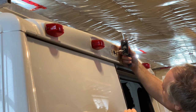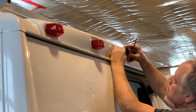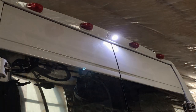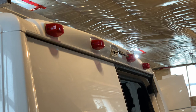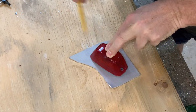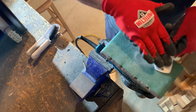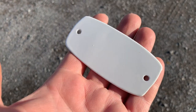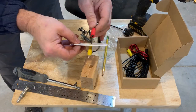I have chosen to remove the rear center marker light and use that location to mount the backup camera. This location works well for two reasons: it provides a good view of what's behind us, and we can use the LED lights on the camera to illuminate the area at night when camping. For that reason, we will not be connecting the camera to the backup lights, but will instead have an independent switch to turn it on when we want. I quickly made a mounting plate out of a scrap piece of aluminum to reuse the mounting holes of the marker light, so we're not drilling new holes in the van's body. Note that the camera did not come with this unit — I've provided a link in the description.